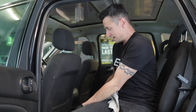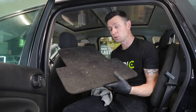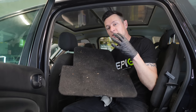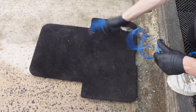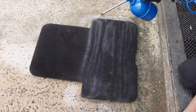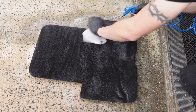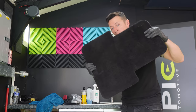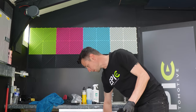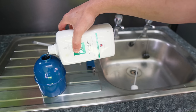I'd like to take this mat and use exactly the same method we just did on the door card. I want to see how far I can push it, because with the other mat we just used the air gun and you could see there were still bits of muck ingrained into the carpet. However, with this one, if we use a degreaser, I'm pretty confident we're going to get some good results. Just for the record, I don't normally use APC for fabric, but this is a dirty demo car so it gives me freedom to explore all the possibilities. So this is the final result using the chemical versus the one we did earlier using just the air compressor on its own — it shows how much better you can perform just by using an APC or interior cleaner with the degreasing gun.